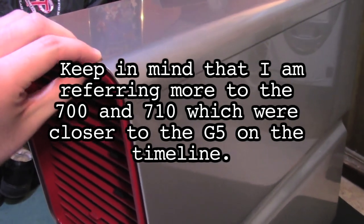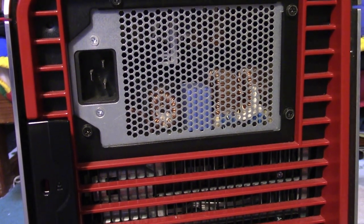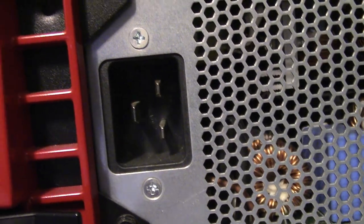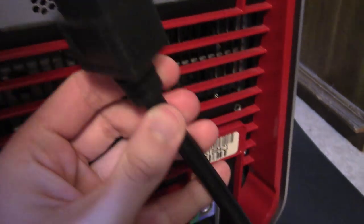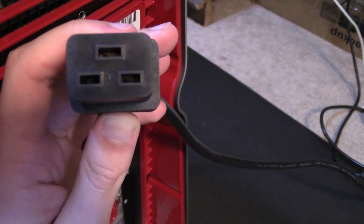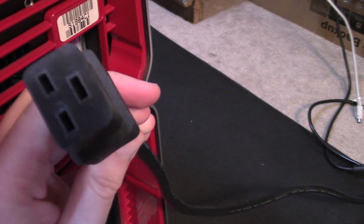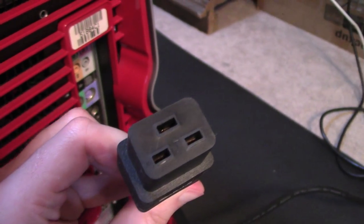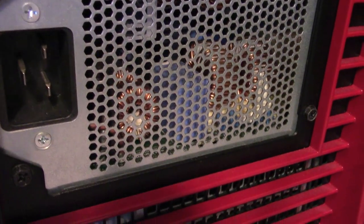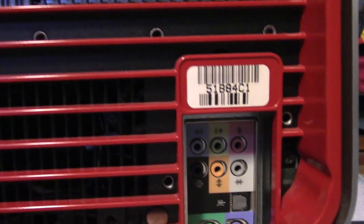They share a lot of things, one of which being this heavy-duty thick aluminum case. Let's take a look around the back. We're on the back now looking at the power supply — this part doesn't look too out of the ordinary other than the fan being on the inside pushing out. It has an interesting power plug that's not something you see too commonly. The power supply is 1000 watts, and this connector is more or less the same as the Power Mac G5 — that strange server-style connector for high-end systems. Dell used it too, so that's another similarity: same wattage and a non-standard consumer connector.